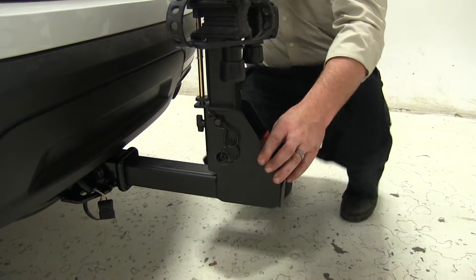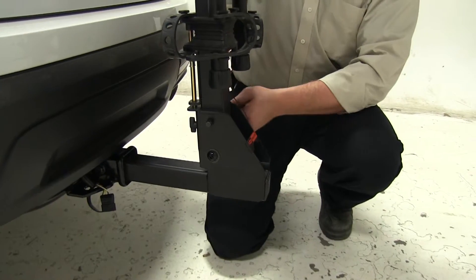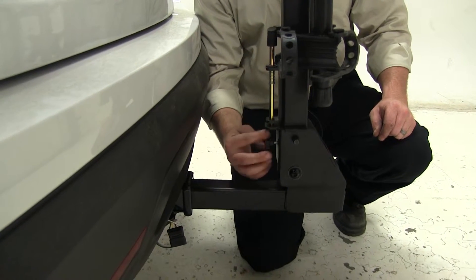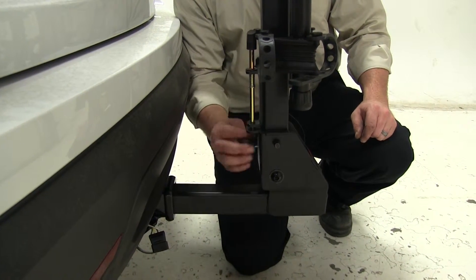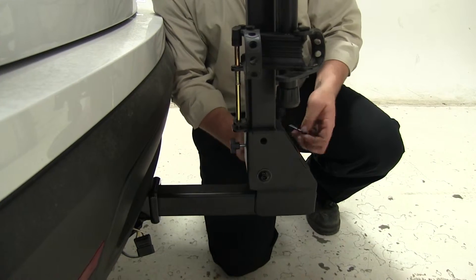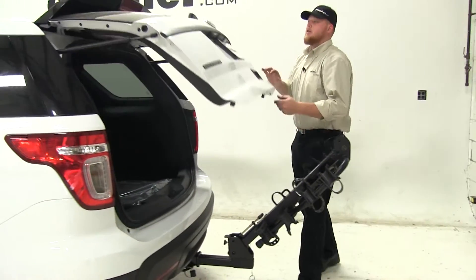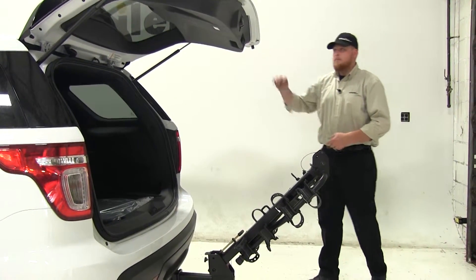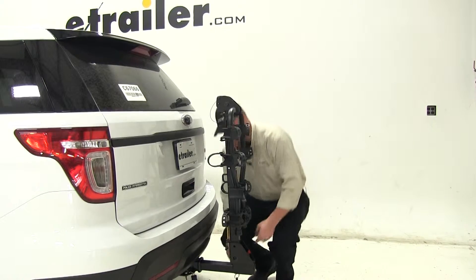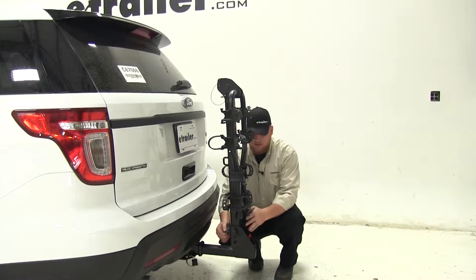While we're down here on this side, we will remove the clip and the pin. To remove the pin, we need to undo the thumb screw on the front, which is going to be our tensioner for our center mast. Once we back that out a little bit, the pin will slide freely. Go ahead and remove the pin and then lift up on the T-handle. This will allow us to drop it down into the tilt position and gain access to our back hatch to place in anything we may have forgotten. Once that's secure, go ahead and raise it back up and replace the pin and clip. With the pin and clip in place, go ahead and tighten up that thumb screw.